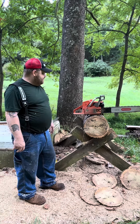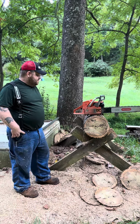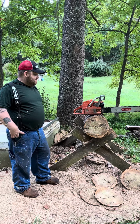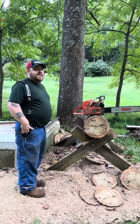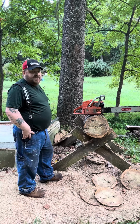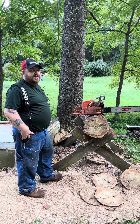Let's say somebody, my guess, somebody started to rebuild the saw and they ran out of talent. Got in over their head, whatever you want to call it. But they had some new parts there. They probably couldn't get it to run right. I would say the missing ring issue, they probably tore it back apart and broke it, taking it off the piston or something. Those aftermarket cylinders come with these really, really brittle cast iron piston rings, and I mean, they will break easy. That's probably my guess. Then they just threw it back together and gave up.